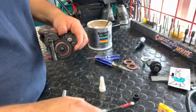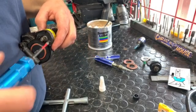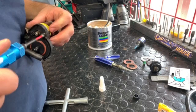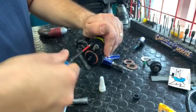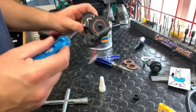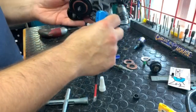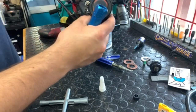We're gonna line up the holes in there, and we're gonna get in there, and then I'm actually gonna teach you guys. I'm gonna show you guys gear mesh and the pro way to do it. It's the OG way of doing it, and we're not gonna tighten them up fully now. One of these screws, so when you take a look at this mount, this one's slotted here, okay? So this is the way this transmission sits in the vehicle, okay? The bottom one's slotted, so what that means is you can actually rotate this motor.